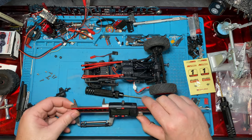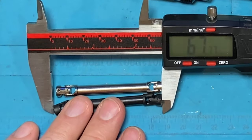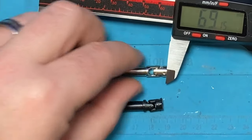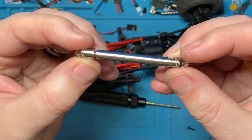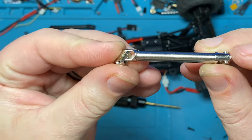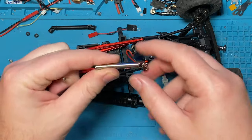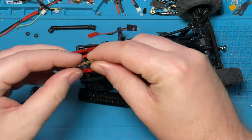Let's go ahead and measure this drive shaft. I believe this is the Gladiator — it's right at 68 millimeters. The one that comes with the kit is right at 70, so it's an extra two millimeters longer. When you put your drive shaft in, always make sure it's in phase — see how the ears are the same. You could have it like that and that is out of phase, so you always want your drive shaft in phase. Also, the open end usually goes to the transmission or transfer case, and the shaft end goes on your axle.